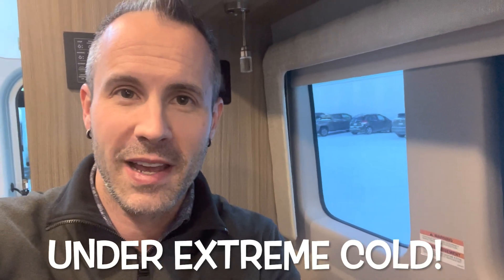So we've performed the test at minus 30 degrees Celsius, and the battery system performed incredibly well. We lost only 3% on our battery in just under 3 hours. We started between 18 and 19 degrees Celsius, and after two hours dropped down to between 12 and 13 degrees Celsius. At that point I turned on the cab heat, and 45 minutes later we were up to 20 degrees Celsius. The hydronic heating system can't quite maintain the temperature on its own, but if you need to boost it, the cab heat does that quickly. The battery system did exceptionally well — this lithium system is totally underrated, and I think it will knock your socks off as far as what it's capable of.